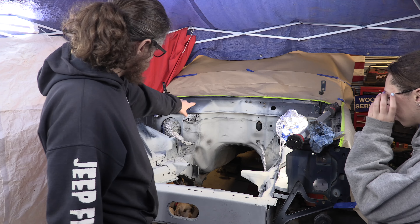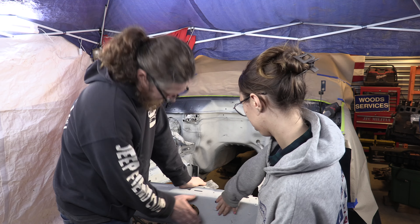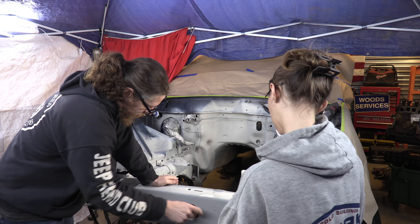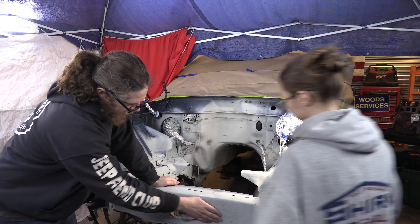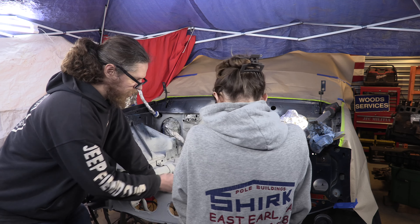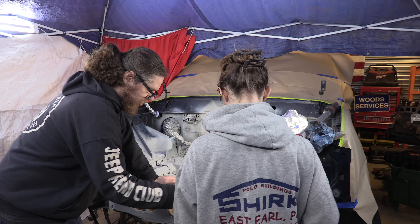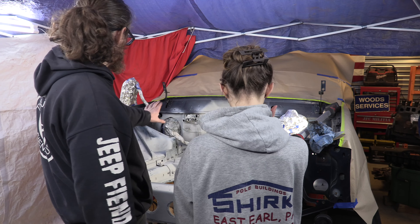So you see the black spray — the black speckles everywhere? Run your hand over the black speckles right here. Do you feel how it's kind of rough? Almost matte. But then if you go over here... let's sand a spot. Now run your hand over that. That is so much better. Do you see the difference? So that black coat, that black spray, is called a guide coat. You can kind of visually see where you've been. We want to take that rough texture off. So you take this — it's 300 grit — and you just sand a little bit, and that will come off.